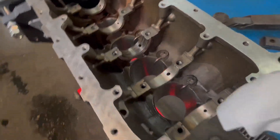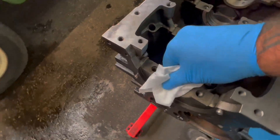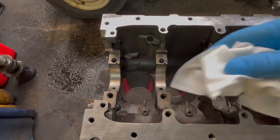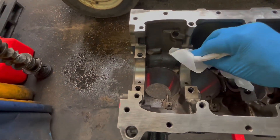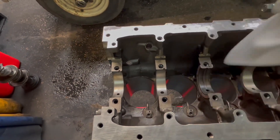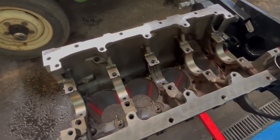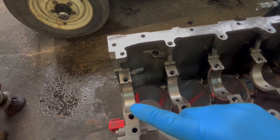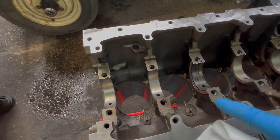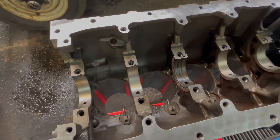Get the crank in, measure the big end bearings, and see if it's all to spec, then crack on. Every time you do something, give it a quick clean, blow it off, and continue putting the rest of the stuff in. It may not seem like a lot of cleaning, but you've got to keep cleaning everything every time - even the back of the shells. Every time you're putting anything in, make sure it's all dust-free, clean, and there's no dirt or anything that's going to contaminate it or get in the way.